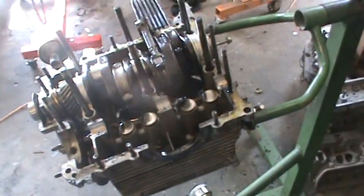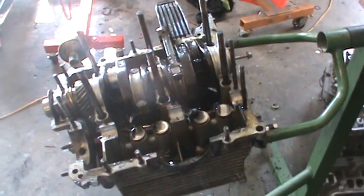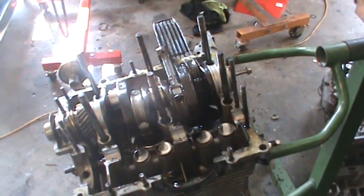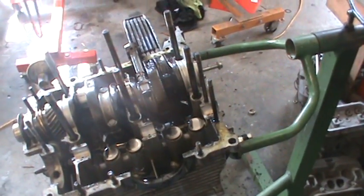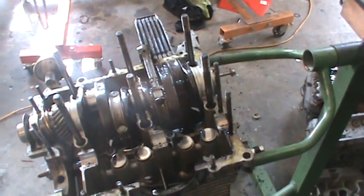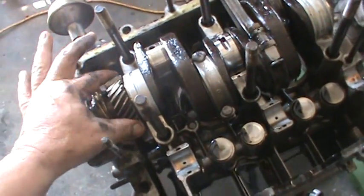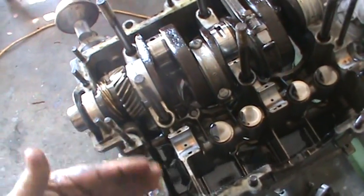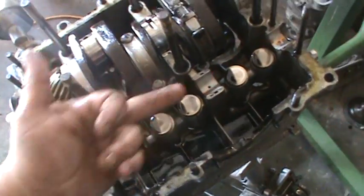Basically a rebuild — a freshen up. I did figure out that these piston cylinders are 87mm; it says 1641 not 1600. I really don't like the 1641 because the cylinder gets compromised when it gets hot — it doesn't have enough integrity to hold up and keep the ring sealed. There's also something going on with the timing gear: it feels very sharp. I think they probably had a mesh issue with the gear — might have taken a plus or minus and just left it, which is why they had all this wear.